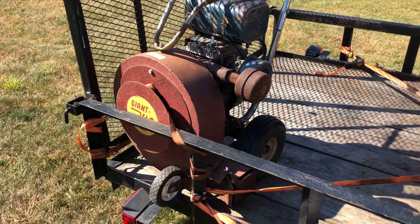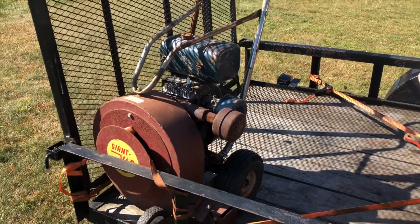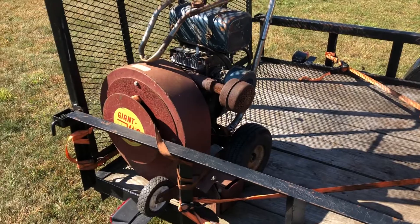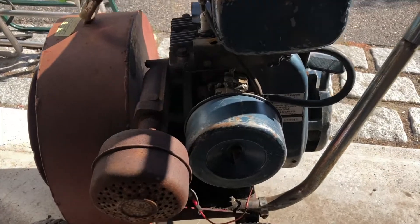That was a good gamble. I'm gonna maybe just clean the points and gap them and see if we get any spark. If not, then it could be a condenser or it could be the under-flywheel coil went bad — that seems to be what's happening to all these old Kohlers lately. So here's the machine.